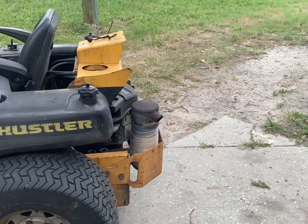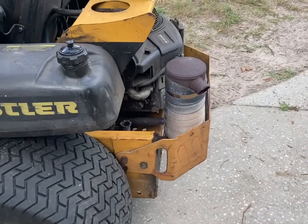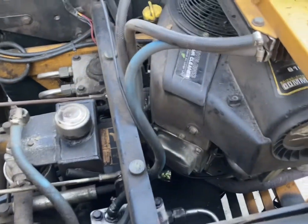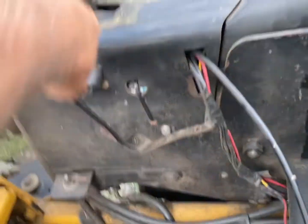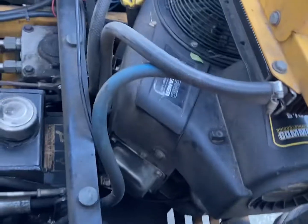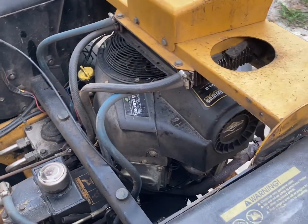Good afternoon. It's that time of year where you've got to pull out all the stops. I just changed oil on this one so I felt comfortable readjusting my throttle cable — I took it to full deflection. This is the little 60-inch. I put my throttle lever to full and pulled the cable forward for full deflection, so I'm hitting my throttle stop and hoping the governor's set properly. I do think I hear a little more RPMs out of it.